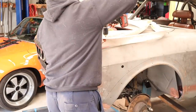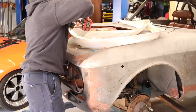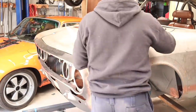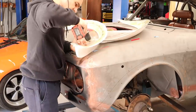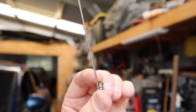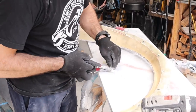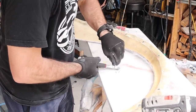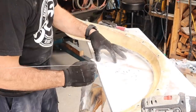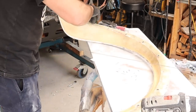I've gone too far to be able to replace the captive nuts with purpose-built square base nuts that I should have used, but I've come up with an ingenious plan. I'm going to drill a hole either side of the existing nuts and cut off small little pins of stainless steel welding rod and epoxy those either side of the existing nuts to lock them in place. Then I'm going to reinforce the whole thing over the back of all of them so they should not move again and will be nice and solid. It is the longer way of doing it, but hindsight is always 20/20.